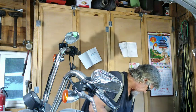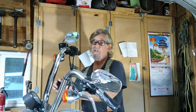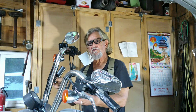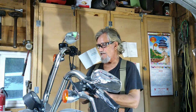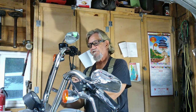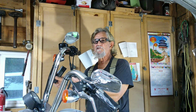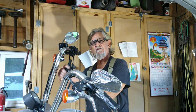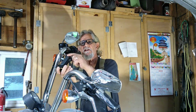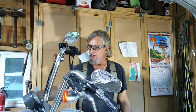The clamps — I forget the name of them — but anyway these wouldn't fit the one-inch bars; they're for one and a quarter bars. What I had to do is buy some and the ones I bought didn't screw down from the top, they screwed from the bottom. In order to fit the one and a quarter bars I had to get that tight. And it didn't have holes here and here for the boltless speedometer, so I had to make some way to put the speedometer on. I just bent like eighth-inch steel, drilled holes in it, and bolted it to that.